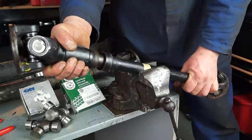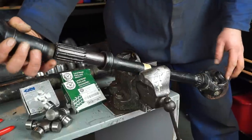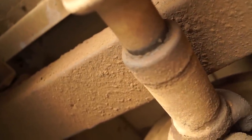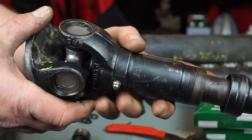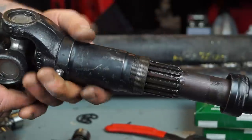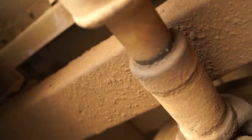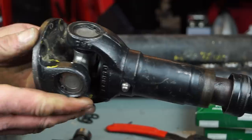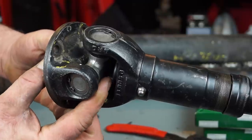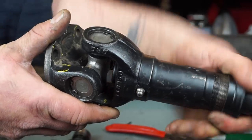First things first, we need to have a look at the slider to see if the splines are okay. I'm exposing the splines here to show you what they look like if you've never seen them before. On this Land Rover 110, you can see the splines are actually worn, which makes it unviable to repair. The splines here have a coating of plastic or Teflon on them and are impossible to repair — you'd have to replace the prop shaft. Grab the prop shaft and twist it to see where the play is. The little rubber valve in here keeps water and ingress out, and you should also make sure the splines will slide. If they're solid, it's no good — chuck it away.